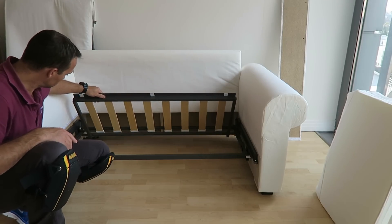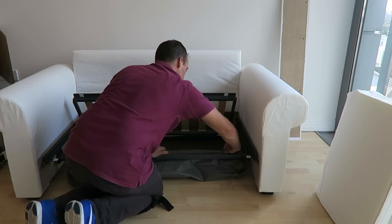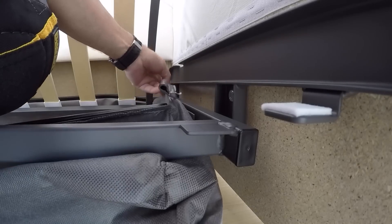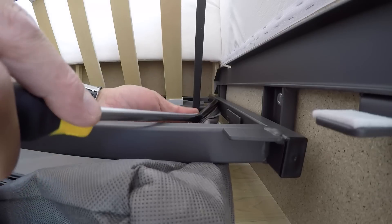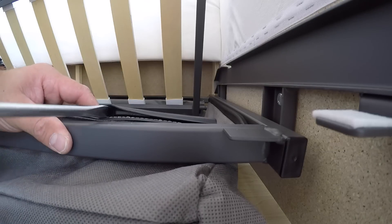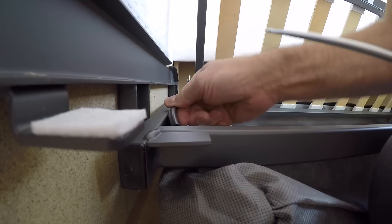The opening mechanism — there's a small storage space. You can see how it works: there's a kind of arrow in there. Once you lift it up it holds; when you lift up again it goes down. So this is the small storage under the front. This was a nightmare to fit in — all those rubbers or plastics around it were going so badly. I had such a hard time. I found out that if you just open them up slightly with a flat-head screwdriver, it opens a little bit and it can get in easier. Just be patient here, don't force it. There it is — the small storage.